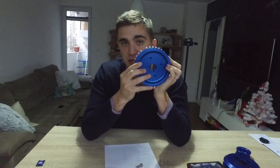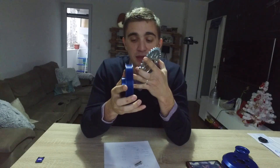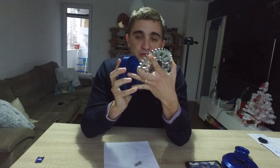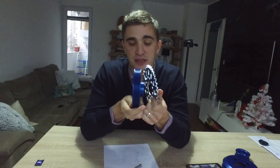In case you have a 20-valve blacktop 4AG engine, the trigger wheel cannot be installed on the back of the crankshaft pulley. You'll have to install it on the front, but that's also not an issue because Techno Toy Tuning has made an adapter plate which goes on the front of your crankshaft pulley. This has eliminated any fitment issues that were present when the trigger wheel was installed on the back in the case of the 4AG 20-valve engines.